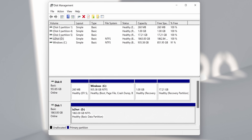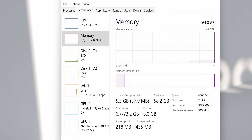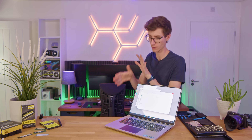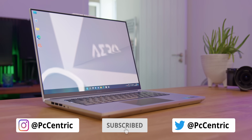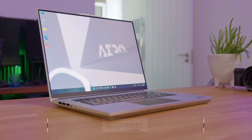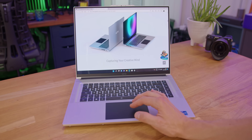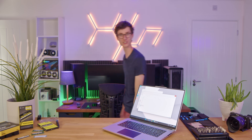Don't swap out your SSD until you've checked that you've got the right one — looks good. Windows was installed on SSD2, not SSD1, which is mildly annoying, but the reason I still wanted you to hang around is to show you that if we go into This PC, we've got two drives in here but only one is showing up. It's just one extra step that Windows annoyingly doesn't tell you: you have to initialize and format the disk. Just type 'disk' into the Start menu, click 'Create and format hard disk partitions', initialize the disk, right-click, new simple volume, and click Next on everything. You can give it a name — I'll call it 'Is Too Hot' — and there you go, the drive is ready to use. I hope this video has been useful, and I'm glad it didn't go perfectly because it shows you there are a couple of unexpected things but they're all very simple and straightforward to fix. Thanks to Gigabyte — links in the description. Thanks for watching, I'll catch you in the next one. I'm going to have an ice cream now.